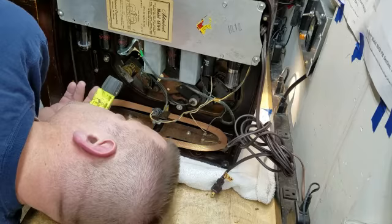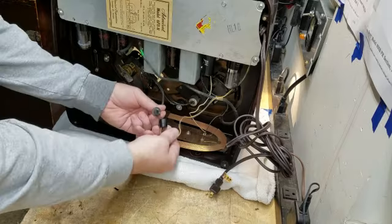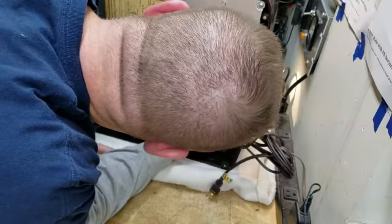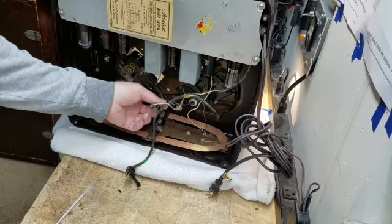Okay, there's one, two, and three record player mounts. The trouble is this chassis has to come out first, so we'll go ahead and disconnect the chassis from the record player. Just this little plug here — that's the power. And I'm sure there's a signal cable. Yes, this looks like a signal cable and that will plug right in here. Admiral likes to use plugs for their stuff. So now the radio is disconnected from the record player.